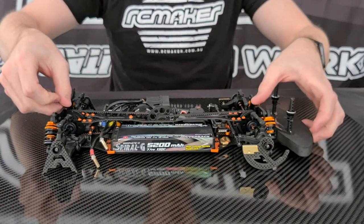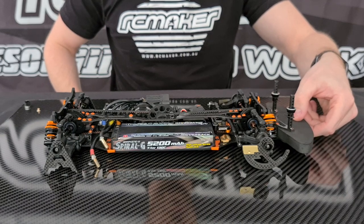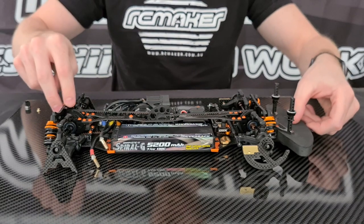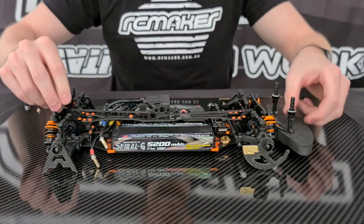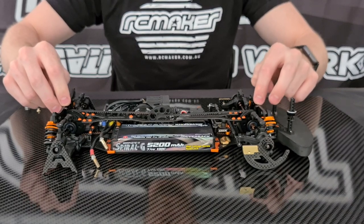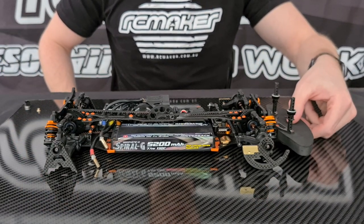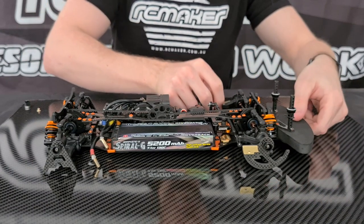That's then going to flatten the car back out. Do the same process again — make sure you're grabbing right in the middle. You can see this one's still coming off early, so we do exactly the same thing a little bit more. Unscrew, screw in, and just keep working your way up in about half turn increments — it's going to make a big difference. You won't have to go a full turn probably on your shock collars.